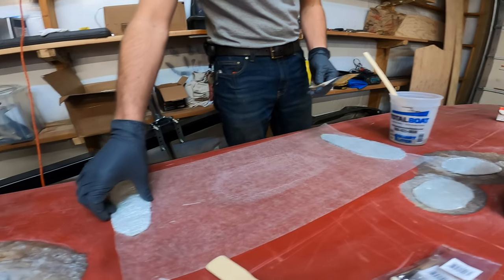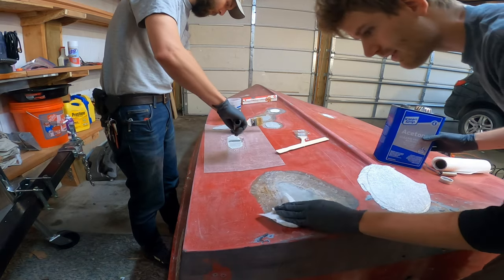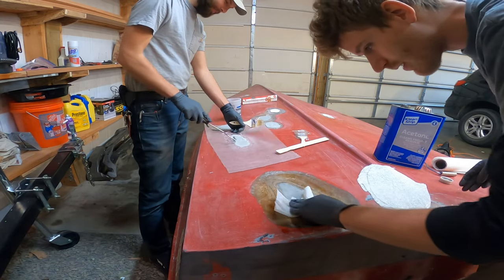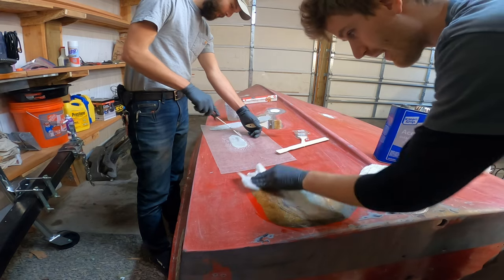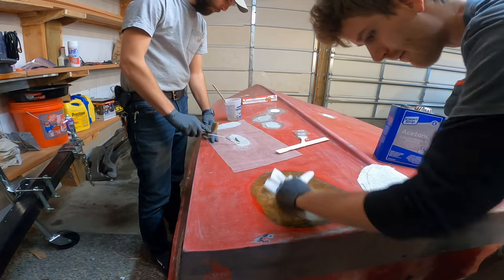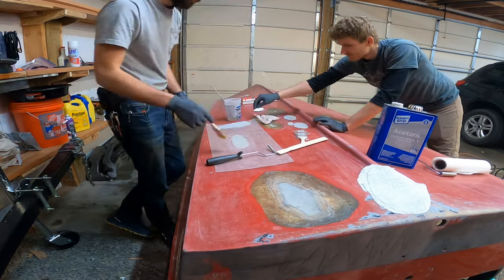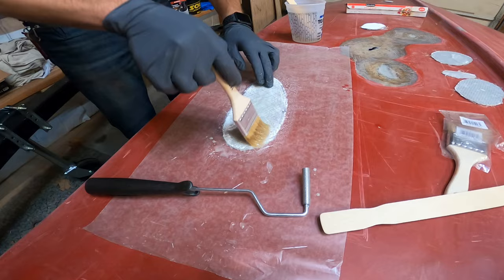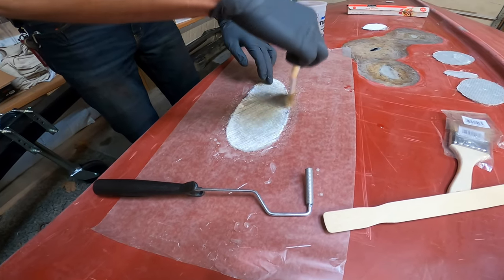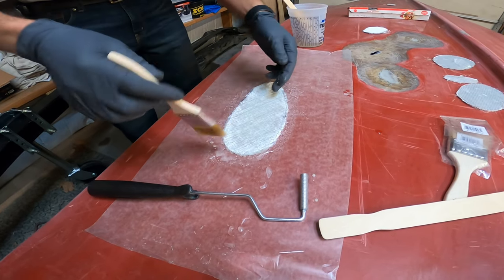So the mat side down. That's for sure. We're gonna put the mat side down on this fiberglass patch. All right, just cleaning the surface with acetone. Getting any debris and particles out of the surface. Yeah, you can make sure the edges are like super damp as well. Also, I don't want to pull all the fiberglass off the edges, but.